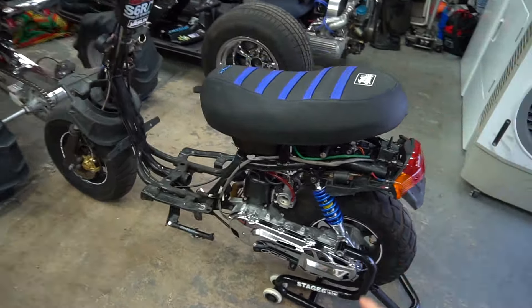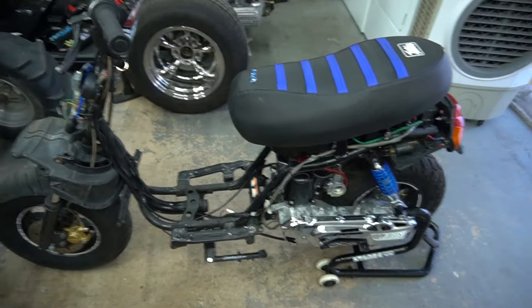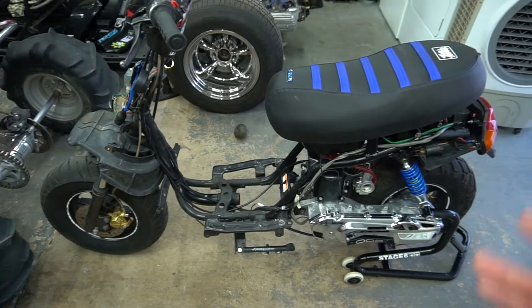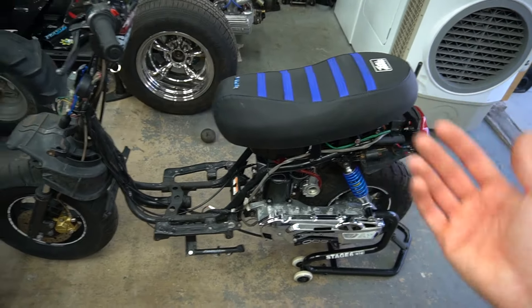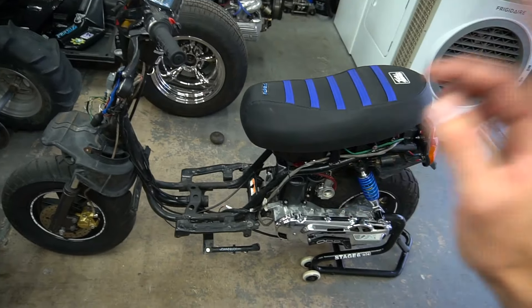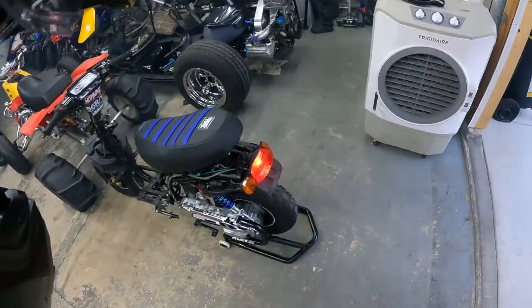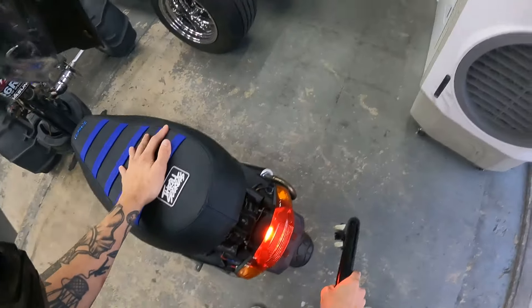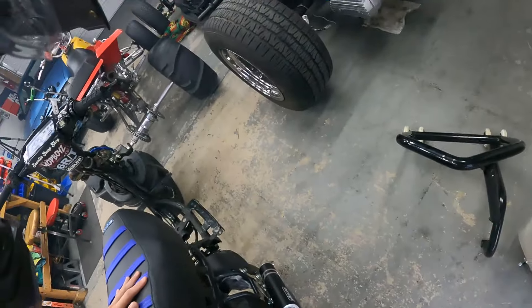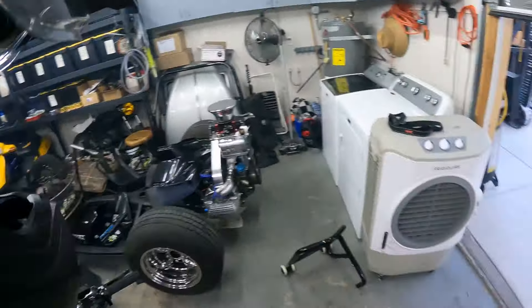It is time. We got the motor swapped into here — the giveaway engine — and we got it fired up. I've ran this thing probably about five times now, let it get hot, let it cool down. It's kind of breaking in the motor, and we are about to do the first ride on it now. I have not tuned it yet, so we will see right now how far off the tuning is, but I kind of set it up to the motor I built last time, so it should be pretty close. I'm excited to give this thing a try right now — just had to remember to tighten the brake. That's always a bad time when you throw on a wheel and you forget to tighten the brake.